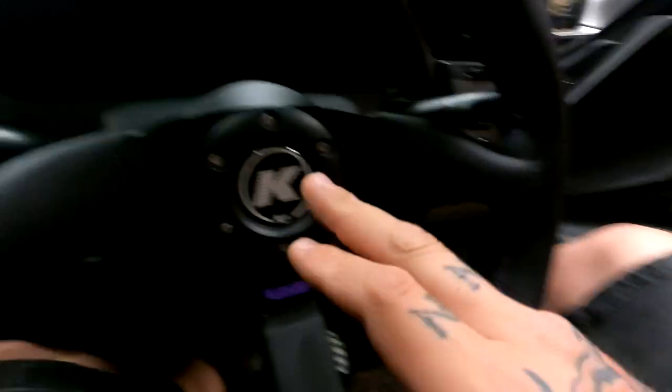Right, she's on. We had a bit of an issue that when we put the steering wheel on and the horn was going on, it was just going on constantly, and we couldn't figure out why. I mean, it's on now. Yay! And it works fine, but behind the horn button is a little metal tab, and that is its ground.